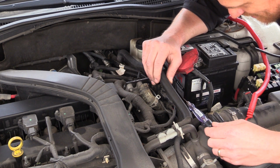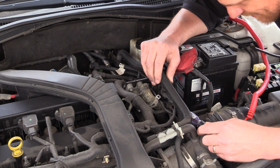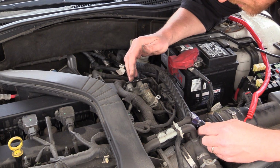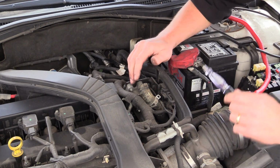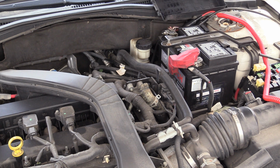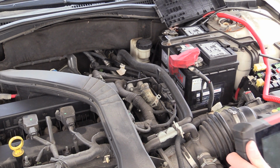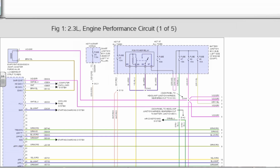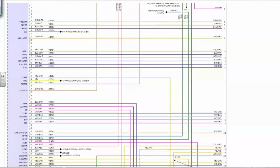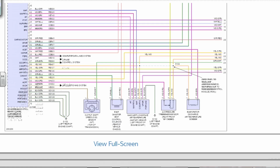Is that tied in? Is that the same driver? Did I miss that in the diagram? That shouldn't be energizing the relay unless it's a shared control circuit for the relay, and I didn't see that. I need to look at the diagram again, because I was surprised that that happened. Well, we've definitely identified the control wire. So they're using one driver in the computer and they're not showing me that.